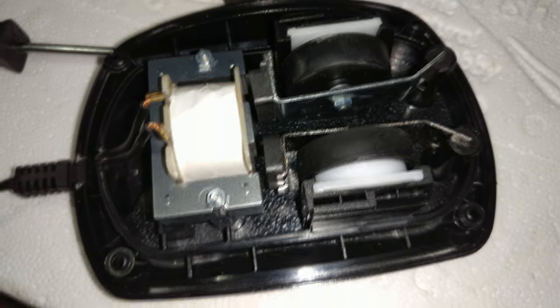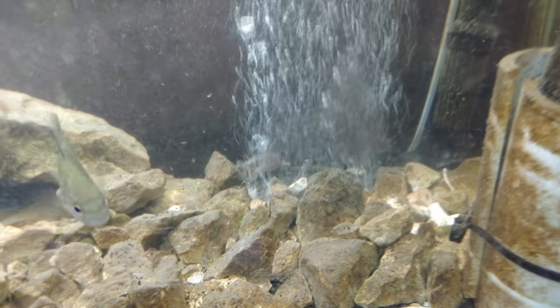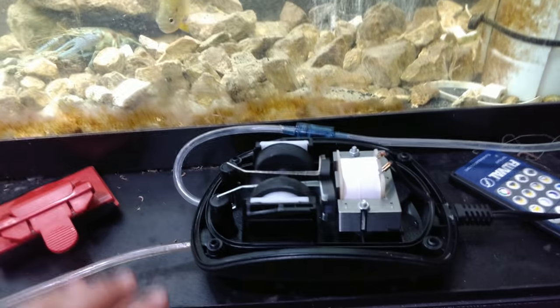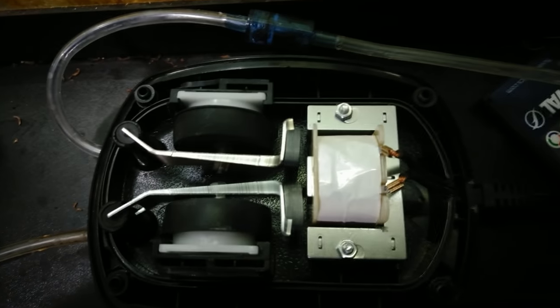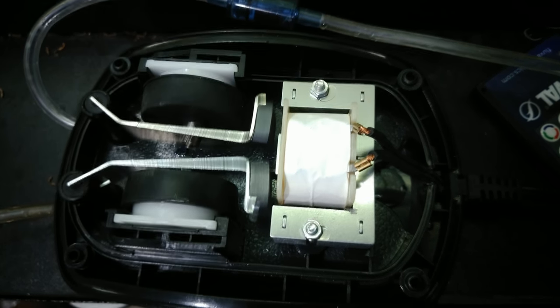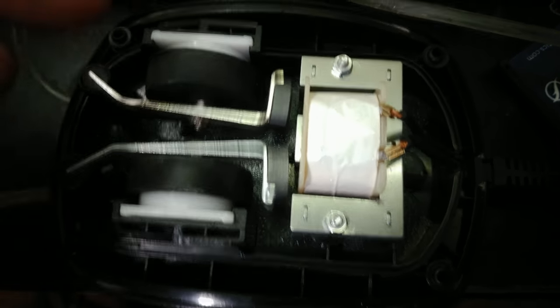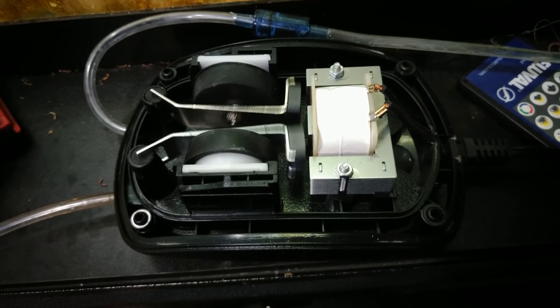We should even be able to hook this up just the way it is right now without putting the top piece back on, just to ensure that everything works. As you can see, we now get a ton of bubbles out of both sides on this air pump and I only needed to replace the one diaphragm. If you look very closely, these parts right here are shaking so fast that it looks like they're in two places at once, but that shaking is pushing the diaphragm back and forth rapidly, forcing air out of the tube all the way down through the air stone. That is how you fix your Tetra Whisper air pump. Pretty simple. All you've got to do at this point is screw the top piece back on so you've got the rubber feet to help silence out the noise.